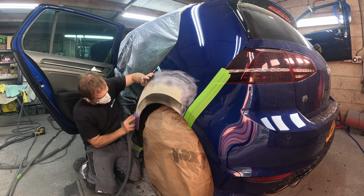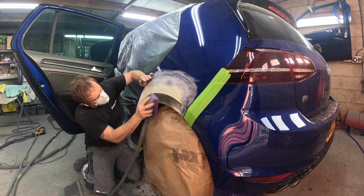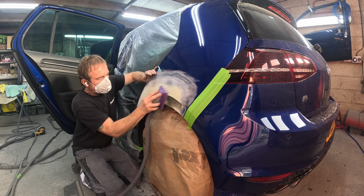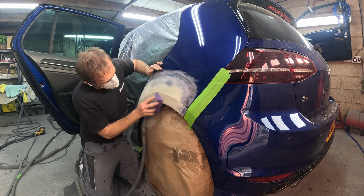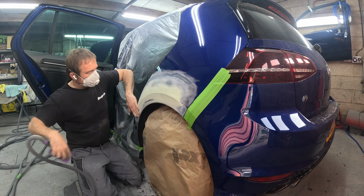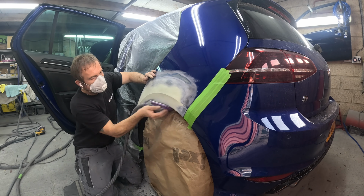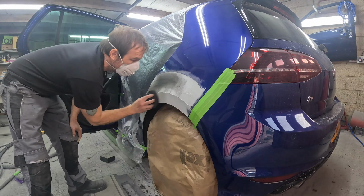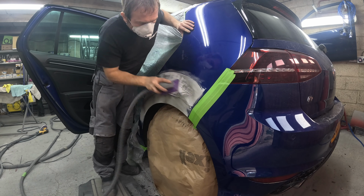scratches, ready for primer. But sometimes if you don't leave enough meat on the bone, if you don't leave a little bit of extra filler on there, when you get your shape in the coarser scratch and go to refine it, you're going to take out that little bit of extra filler, and you could lose your shape. And that happened on this. I got there with it, refined the scratches, thought it was there, and it didn't feel as good as I wanted it to feel.